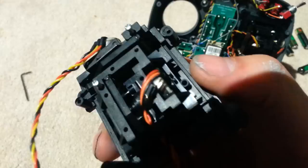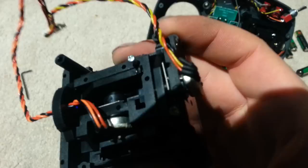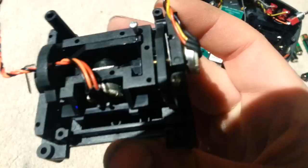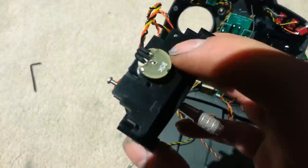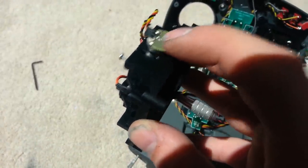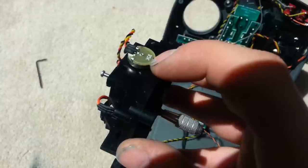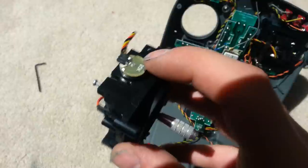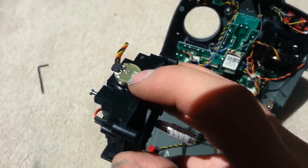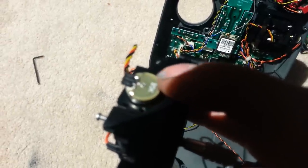On the back of the control unit there are two screws that torque your springs in. You will need to remove those — I'm not going to remove them in this video because it's a bit difficult to reset those springs, but it can be done. There is also a retainer clip. This is your pot right here — this was my bad pot. You're going to need to remove it using the retainer screw. Once the springs are removed and levers released, you can remove that pot. Then these three little clips around the top of the pot, you can bend those back very carefully. The pot top will actually come off, and on the inside there are little roads that fingers ride on to feel where your control is.